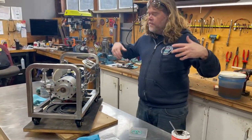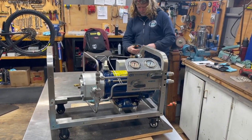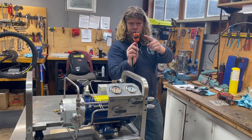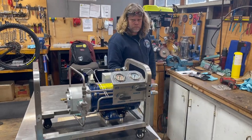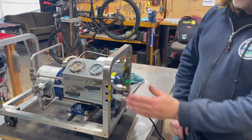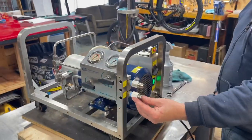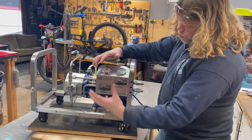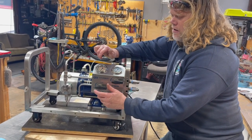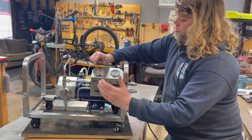Okay, that was the top end — now we're going to test it. We're going to plug it in. This is obviously not explosion-proof — we only recommend the use of explosion-proof plugs; it's up to the client to figure that out. And here we go — got good air pressure coming through. It feels a little bit slow, but that's okay. If you're not getting much airflow, it's probably because the shut-off valve orifice is closed — that's a forty-dollar part and a very common replacement. If you're not getting good airflow on the output, just replace it.